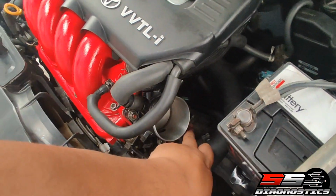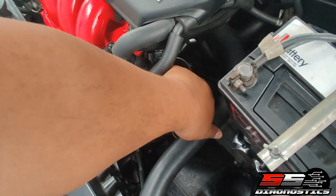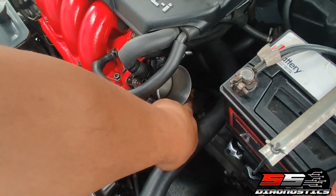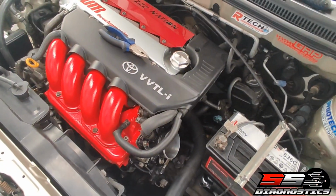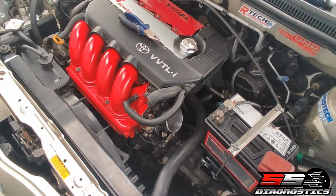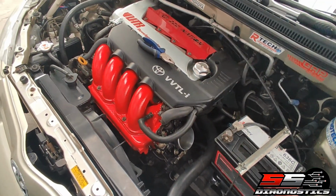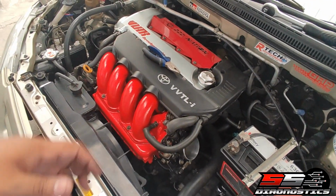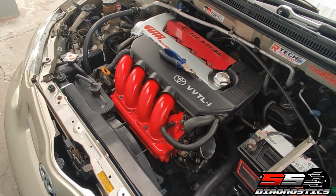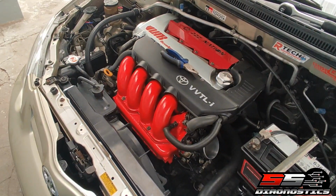And that is the reason also that you see this here. The pipes normally come from here, one in and one out. So I just block those pipes off, and there's no pipes going to the ICV. That is more for colder, very cold temperatures, like below 3, 4, 5 degrees. It doesn't get that cold here in South Africa, so yeah. But I'll just continue and then start up and see. Hopefully the car will be idling properly now.